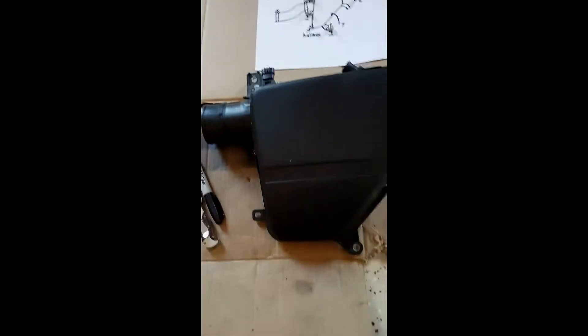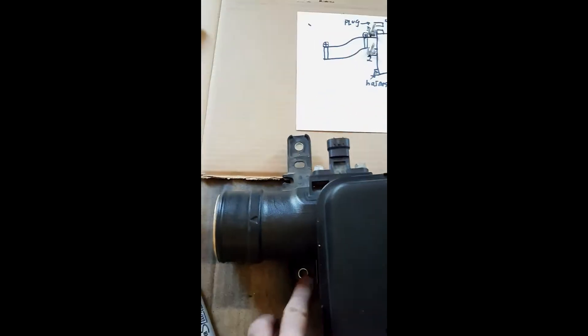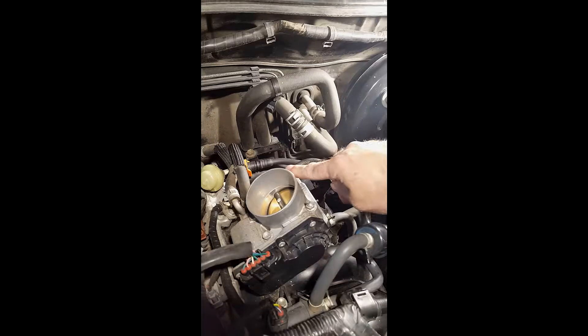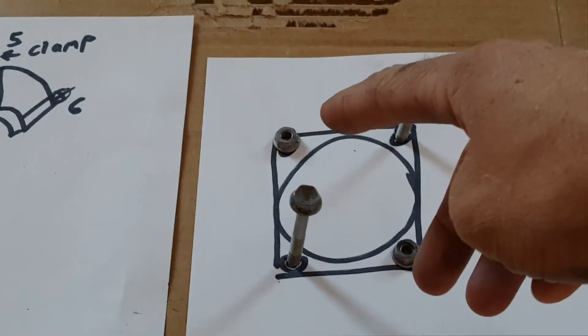Just to review: there are really three bolts holding this thing in — one here, one here, and one here. As you go around there's a bolt, a wiring harness, another bolt, another bolt, a vacuum line connecting here, another vacuum line connecting there. This connects to the throttle body right here, and there's another vacuum line that connects there. To remove the throttle body there are two bolts and two nuts on studs — two sides have bolts and the other two sides have studs with nuts.